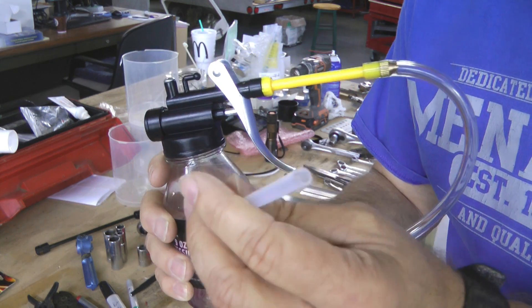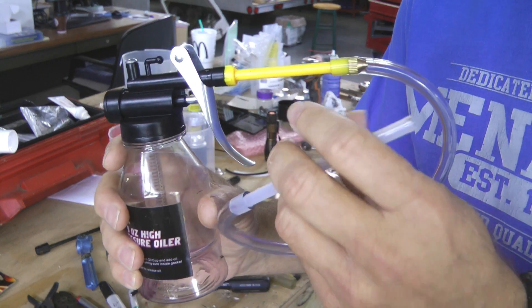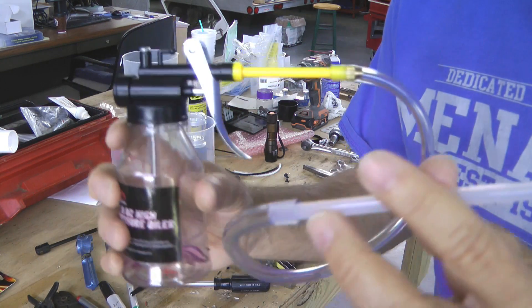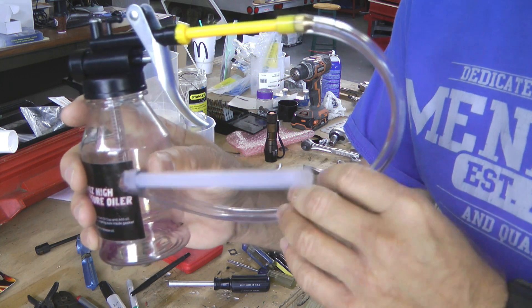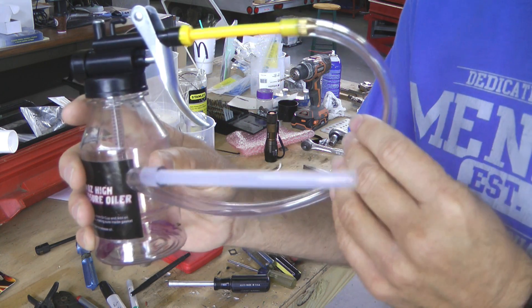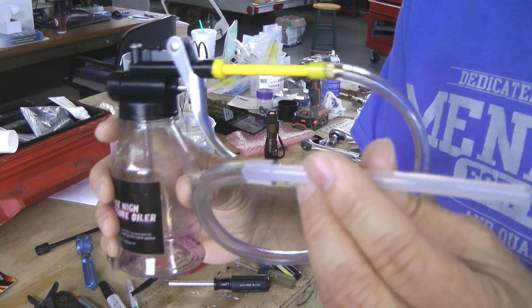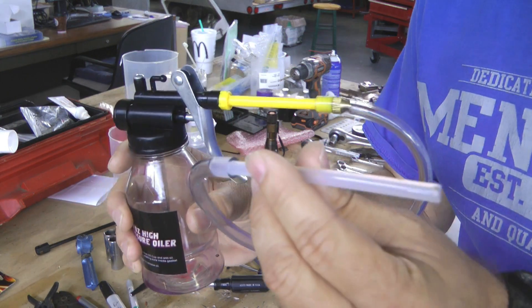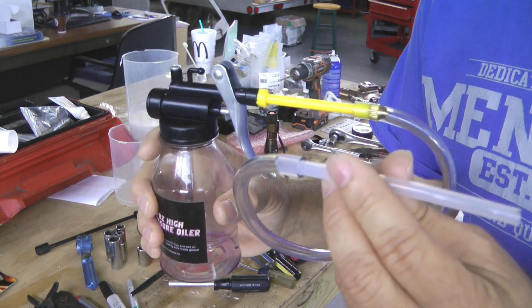By purchasing a small piece of quarter-inch nylon tube — very popular, you may already have it in your aircraft for your pitot-static system, and it's available at the hardware store — it fit into my tube very nicely. Because this is nice and rigid, it forms a very nice seal over the bleeder valve on your brakes. A little hard to push on, but that's good. Run to your hardware store; if you're not sure what size to get, get a number of different sizes. This is all very inexpensive tubing, but with the proper sizes and your squirt can, you'll have a very nice system.